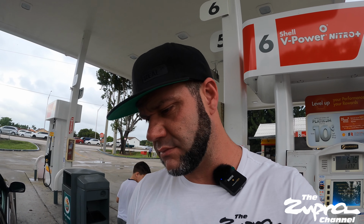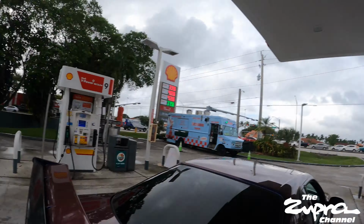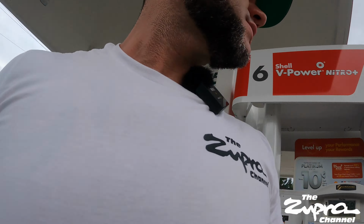Like I said, the brakes are really, really bad. They're spongy and they go all the way down. So we definitely need to re-bleed the brakes. It's misfiring a little bit above 3,000 RPM, I want to say. Right now I've just cruised it over here, probably at 20, 25 miles per hour, so it's inside my complex area. So it shouldn't be too bad.